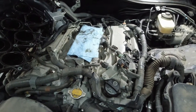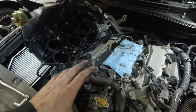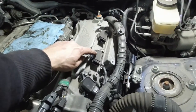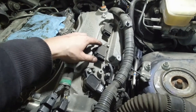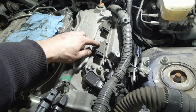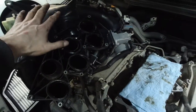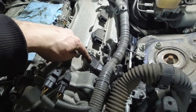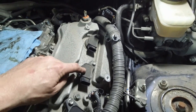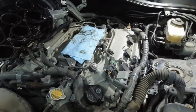Kind of reverse engineering, I guess, if you're doing this job. Why it's a bit more difficult than usual? Because the intake is in the way - mainly this bracket right here blocks the middle cylinder. The driver's side middle spark plug is the problem. That's why you cannot do this without taking this off. This one is somewhat accessible, this one you could probably get away with, but this one is the problem. Let me show you - it's not very difficult if you know where the bolts are.